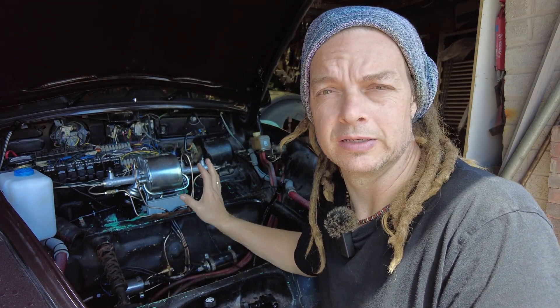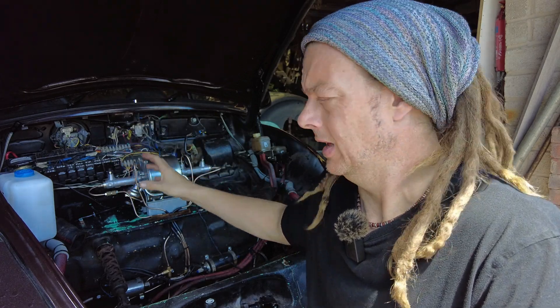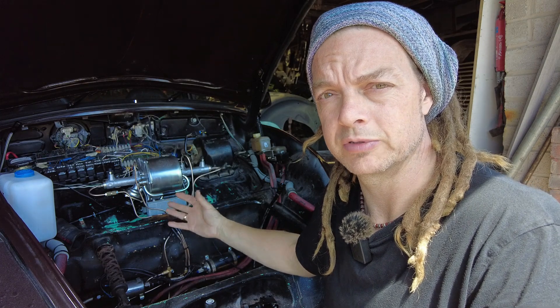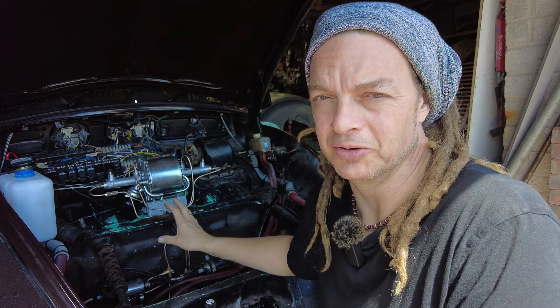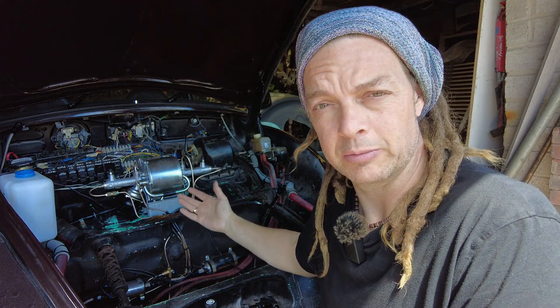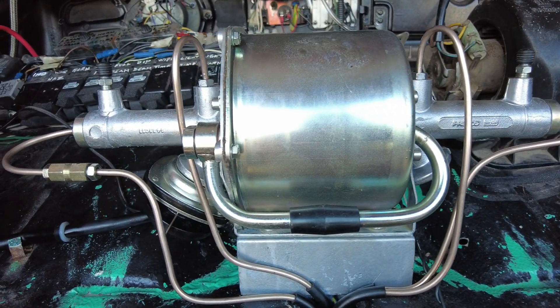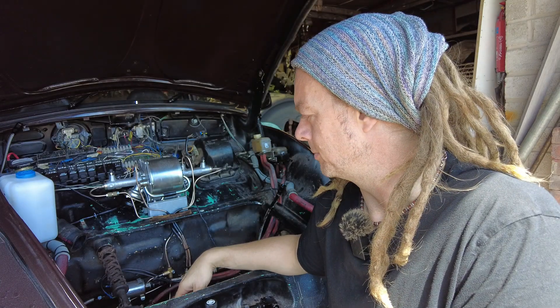We are back - it's been actually a few weeks since I was last filming here and everything's pretty much done. I had a bit of a nightmare with the bleeding. On top of the bias valve issue, because we've taken the pipes off so many times to switch it around and switch it back, and probably because I over-tightened all the nuts, we actually ended up over-crushing the end of a lot of the pipes we've made. So then they leaked because they were bottoming out on the nut before it actually sealed. As a consequence, I had to take a lot of the pipes off, cut the ends off them, and then remake them. They're not quite as neat as they originally were, but it still looks pretty decent.